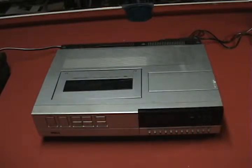As for the actual specs for VHS, it has 3 megahertz of video bandwidth. And you have your chroma and your luma. And for audio, it started out as a single linear track, and then it went on to stereo linear, and then hi-fi came out about 1985 to go against Beta, because they came out with their Beta hi-fi. And hi-fi is CD quality.